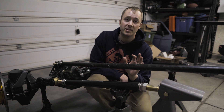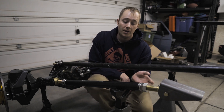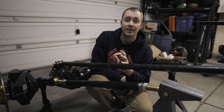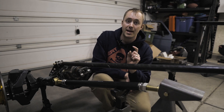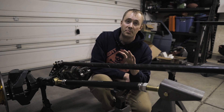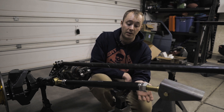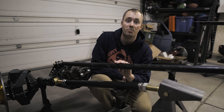When it comes to upper link material thickness, I'm going to be using one-and-a-half-inch quarter-wall DOM. The reason I'm not using as large material as my lower links is, first, the upper link is tucked up out of the way and should never take impacts. Second, it runs right next to my driveshaft with very small clearances, so I needed a narrower piece of tubing. Use what you're able to fit in there — if you can put a beefy link in, go for it, but it will be heavier and isn't as necessary since it won't take impacts.